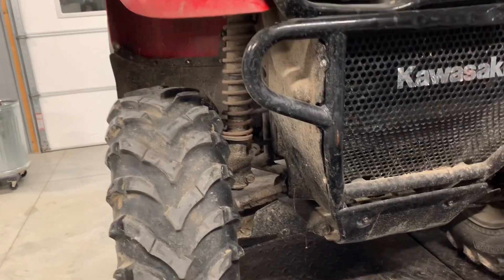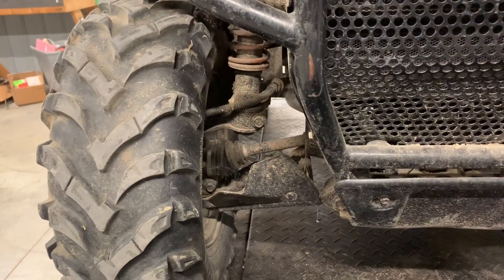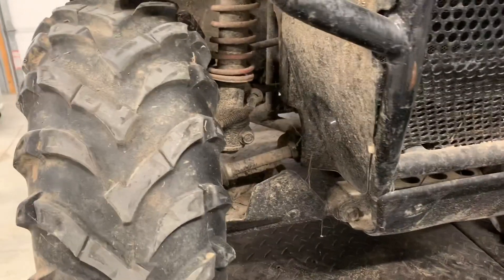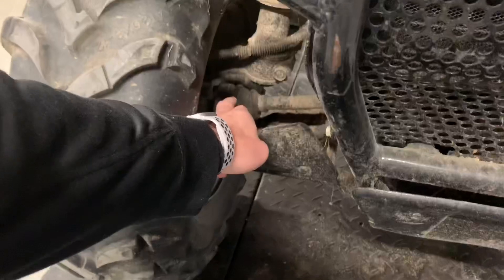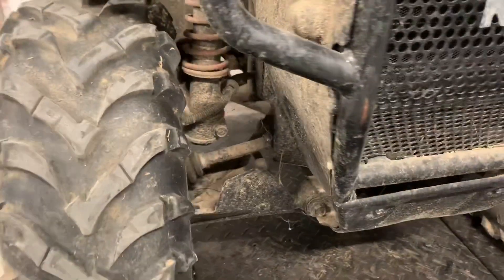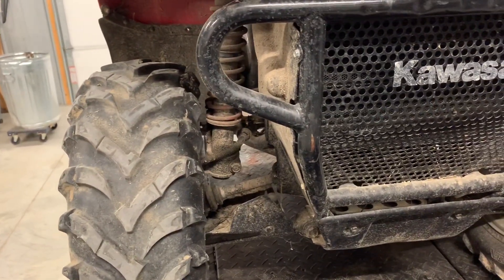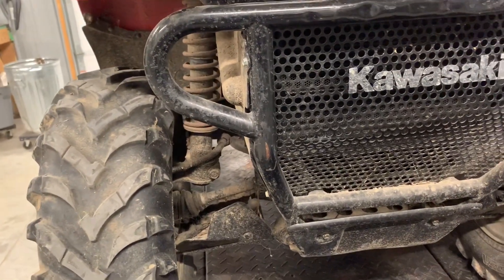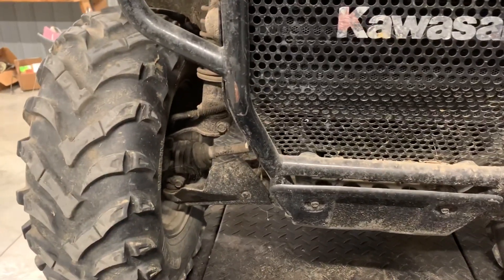This is a four-wheel drive model, so you've got your front drive shafts — your CV shafts, or front axles as some people call them. They've got CV boots on there, and you want to check those every time for any sort of rip at all. There are two boots — one right there and another kind of behind that plastic cover. Replace those immediately when you see rips or grease coming out. Otherwise, you're going to be replacing the entire axle or at least that joint. It's cheaper to get that done right away.